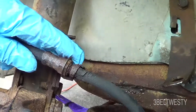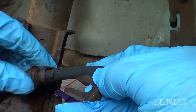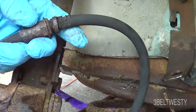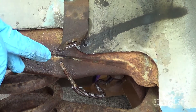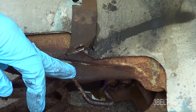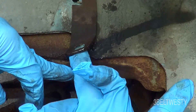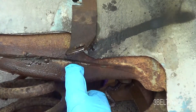I took the clip off over here — and look at this fitting: these two parts aren't even connected together anymore. The steel is completely rusted through, so there's no flow through this pipe. This is weeping out here, which is good. I'm going to replace this anyway, so I'm going to go ahead and put a flare fitting on this right now just to get going. This is the passenger side — it's got two little slots here on the 82, and the other side's got a hex.